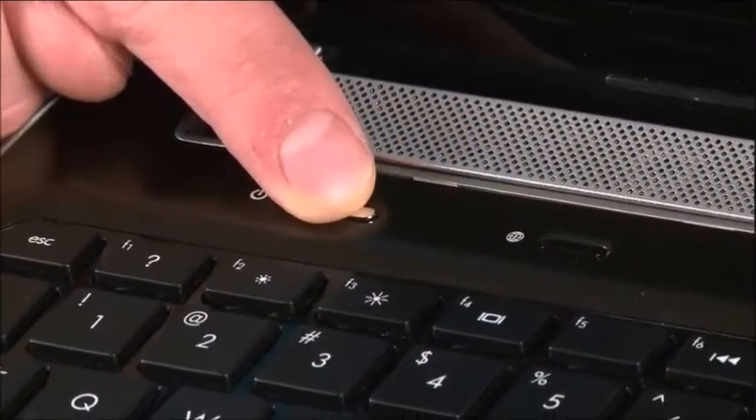Also do a drain cycle: take the power off completely and with the battery out, hold down the power button for a good 30 seconds while it's unplugged. Then put the battery back in and see if the laptop powers on. It's also possible it could be your power jack — where the power cord plugs in. If that's loose or disconnected from the motherboard, it would need to be soldered back on, which takes more labor. Ask around for a good rate on that repair.